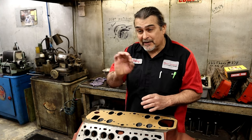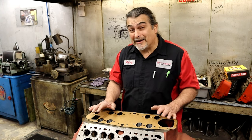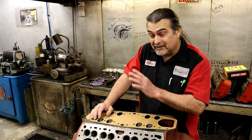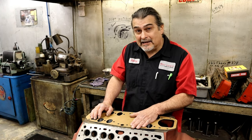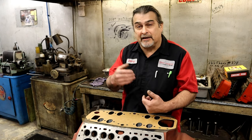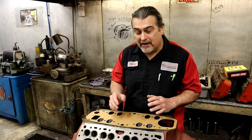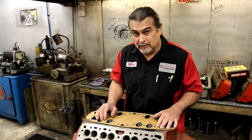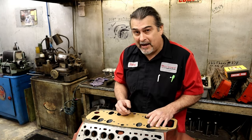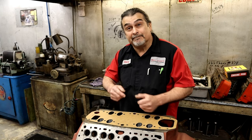There are actually people putting dimples in their ports for enhanced airflow, but rough is fine on the intake port. The exhaust ports can be polished. Don't spend a lot of time polishing unless you really like polishing. Port matching will enhance a vehicle especially when ports are this far off — you're just trying to not take away from the build. You want to build the best engine you can. If you start porting beyond that and don't have a flow bench, leave it alone — you're probably going to slow your air speed down. Nobody wants a big dead hole. Hope you've enjoyed it, hope it's been educational and enlightening on port matching. I'll put two videos of the port matching work in the earlier part of this video — see you on the next one.